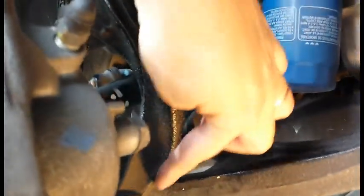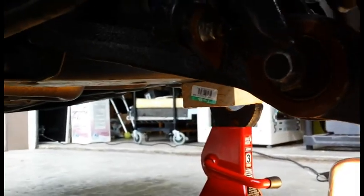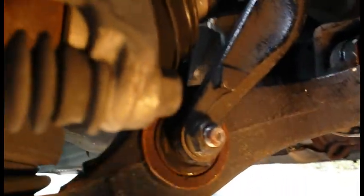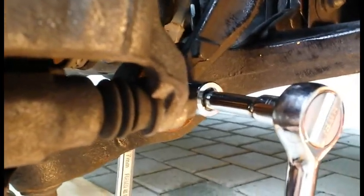I added some light so you can see better. This fork is shaped like a horseshoe and it attaches right at the lower control arm. It's got a really massive bolt that goes all the way through. You're going to need to put a 17mm socket on the bolt side and a 17mm wrench on the nut side, otherwise you're never going to get it out. Go ahead and loosen that, then you'll need to hammer it out as gently as you can.